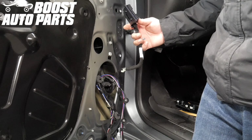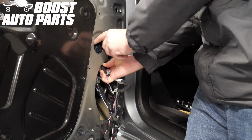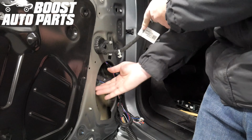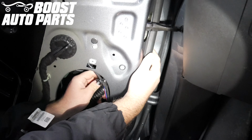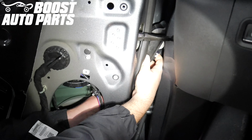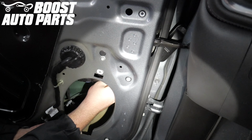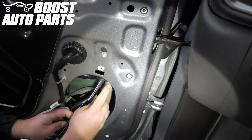After taping the modified door harness into place, start by reinstalling the door harness into the truck. Bring the door jamb connector back into the door jamb area. When routing the door jamb connector, make sure the mirror harness wire is not in front of the wire going to the door jamb. It needs to be on the outer edge towards the front of the door.